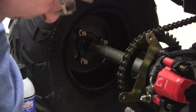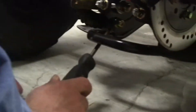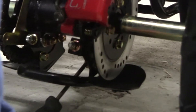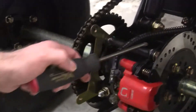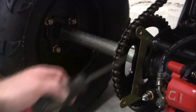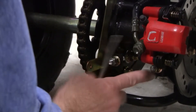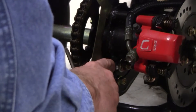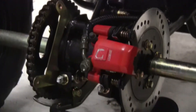After that, you're not going to remove, but you're going to loosen this nut. On the other side is the same nut down here. You're going to loosen this nut here and then this nut over here. This has two nuts here, so you're going to loosen the outside nut, and then you're going to use the inside nut to tighten the chain or loosen the chain.